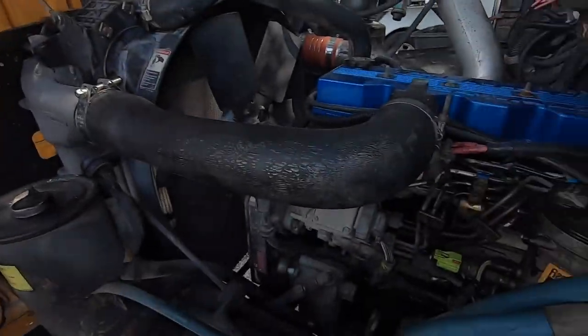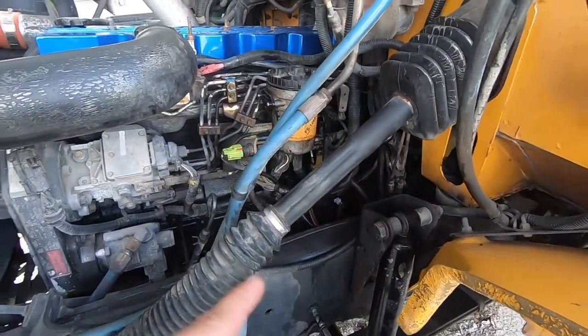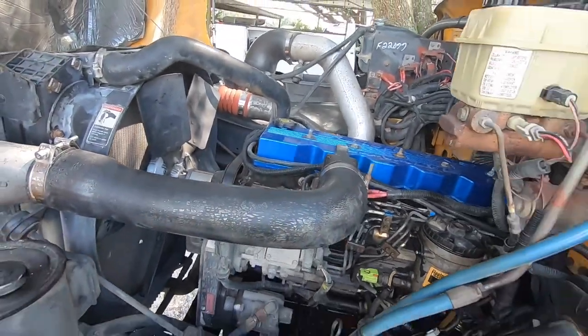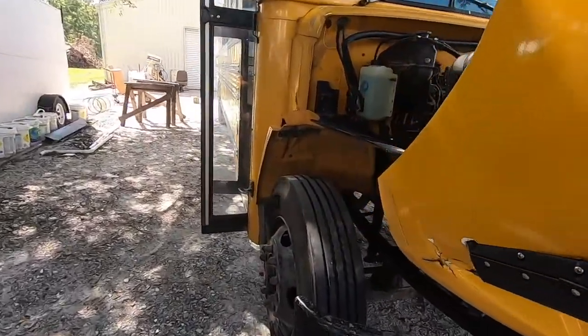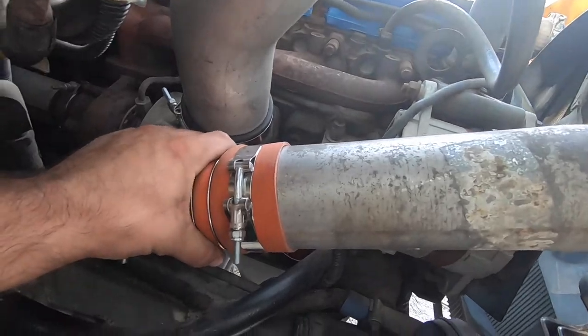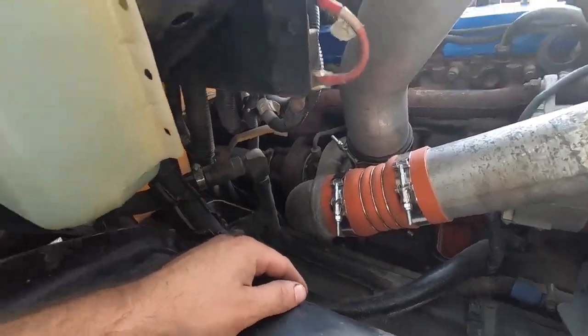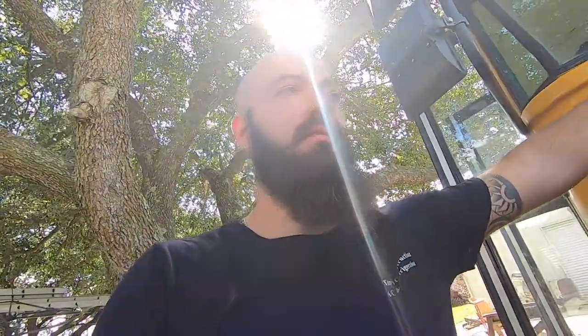Previously on Paris Schooley: the lift pump has been changed, wires need to be zip tied back together. I had a check engine light for this lift pump since I got the bus — it came up a couple of times, but this is the first time it continuously came on. The turbo has also been sounding like it's sucking air, a real whiny sucking-for-air sound over the last week. Now that I've changed the fuel pump, the check engine light is off and it runs a whole lot better, but we're still having that sucking sound — that air issue. So I'm having air problems and fuel problems this week.